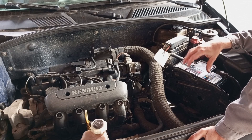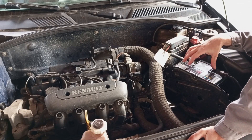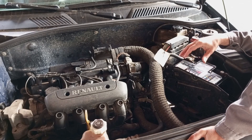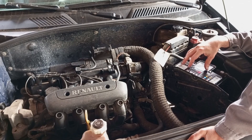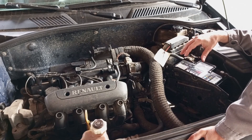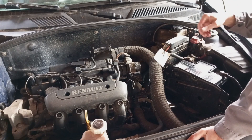Once you're done, it's good practice to check the alternator voltage on the battery using a multimeter. If you see an output of 14.2 to 14.5 volts from the alternator, everything is okay and the battery was depleted for some reason — low temperatures, a bad battery, or something left on inside the cabin. Also, about an hour after mounting the battery, try to start the car again, especially in cold weather. If the battery doesn't want to start again, in most cases you have a bad battery and should consider buying one — it simply doesn't hold the charge.